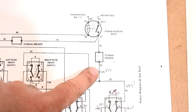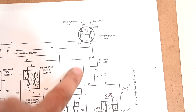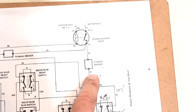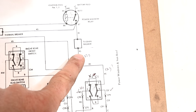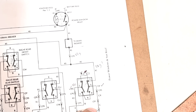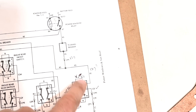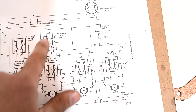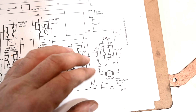Let me explain this on the wiring diagram. Here's our fuse; the wire we checked that had power is coming from the power window relay, which itself gets power from the battery. We checked for ground here and found no short to ground right now, but we probably did when the fuse first blew. If you check and don't see a short to ground, the short could be in other parts of the circuit. You want to split up the circuit and check for ground at each split — go to the switch, check for ground there — to narrow down and find where the short is.